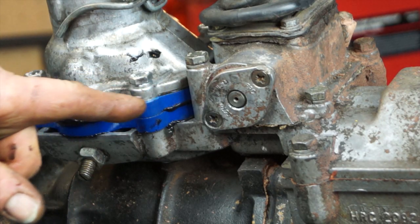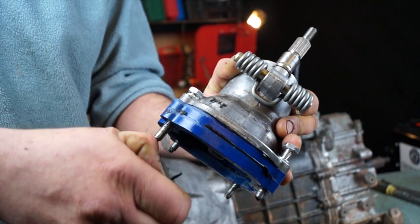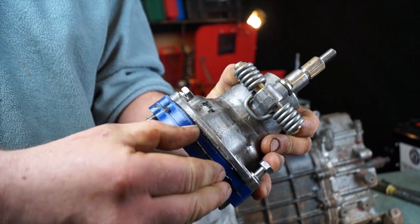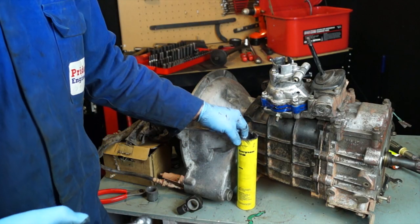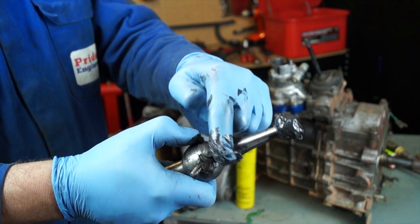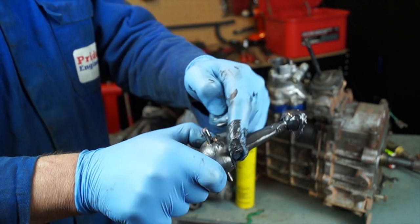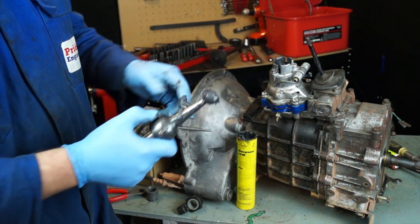Once that's done you'll see a little squeeze of silicone around the joint. Wait until it's dry and then peel off the excess — don't wipe it while it's wet as it makes a real mess. The next thing is to apply some grease to the lower gear selector where it contacts certain components. A molybdenum grease is used here, but multi-purpose grease is fine.